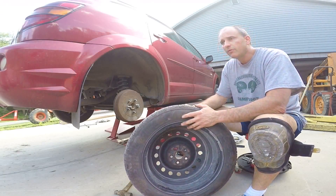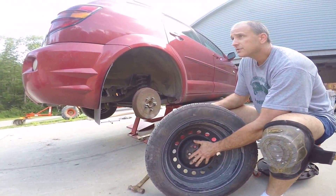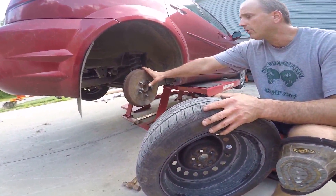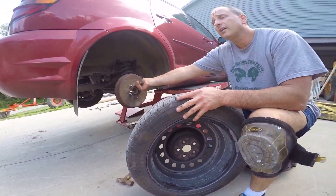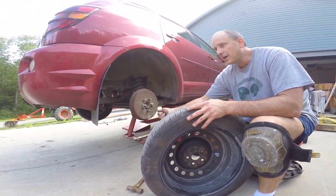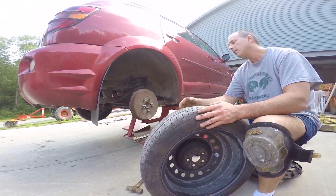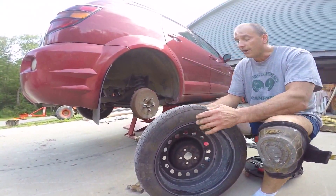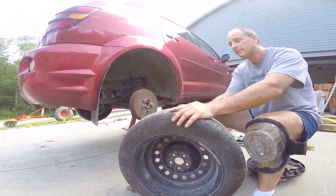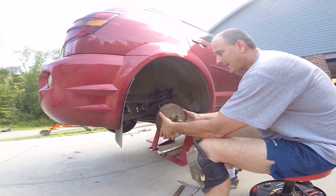When I went to remove the wheel, the back of this rim was just stuck really hard onto this drum — it was galled on. You have to thread a lug nut on, not all the way but almost all the way, then come from the bottom side with a sledgehammer and bang on the rubber — don't hit the rim — and then it loosens. Take your nut off and the tire comes right off. When we go to put it back together I'll share a tip so that doesn't happen next time.